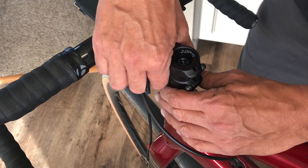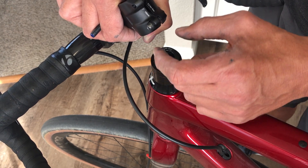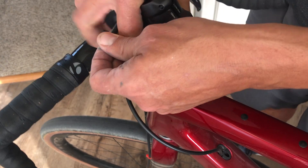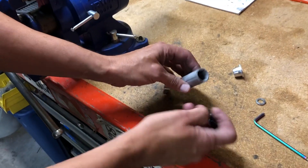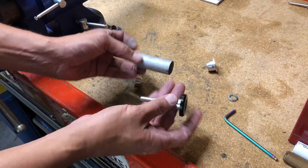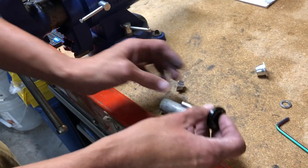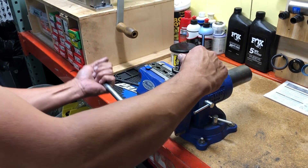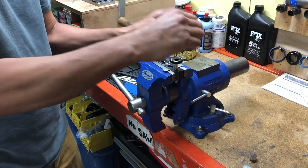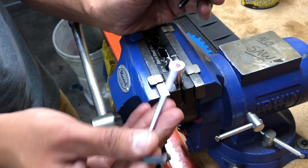The second potential issue is that if the compression plug isn't quite tight, it can migrate its way up and bottom out against the top cap, causing the same problem. I've got an example where that happened — the dreaded compression plug dilemma, we can't get the headset tight. The bolt is stuck into the bolt that activates the compression plug, so I'm going to put this in the soft jaws. This guy just got tightened and bottomed out against the top of the bolt.